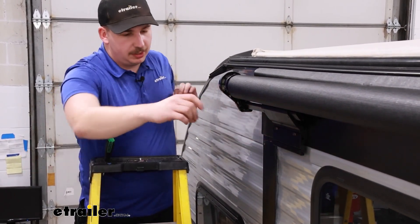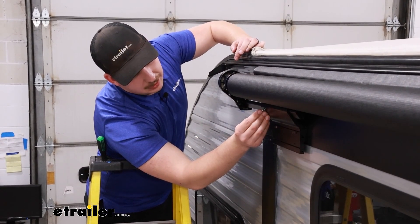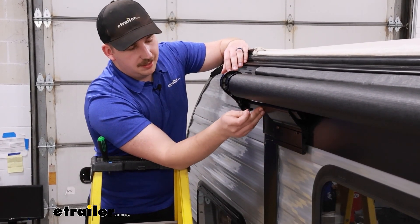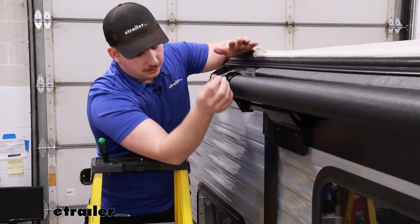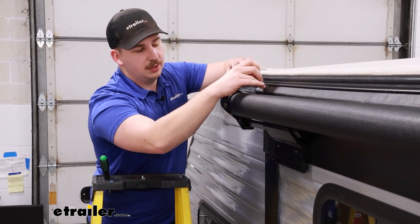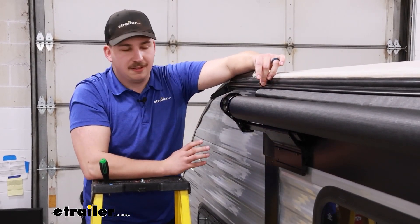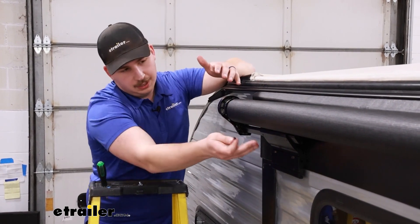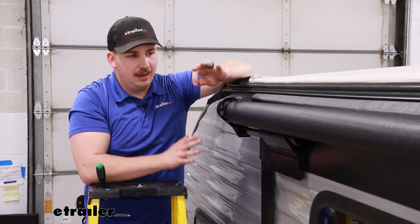The other thing to look at is the two silver self-tapping screws in the kit — those will go into the extension arms through the two holes up here. Because we're doing this for demonstration purposes and not leaving this installed, I'm not going to drill these in permanently, but it is completely necessary for your install if you're leaving this in place. In addition to that, there are two smaller black self-tapping screws that will go in place up top to hold the anchored end of the slide topper into the channel, just going in about an inch to hold it in place. All of those screws are completely necessary — you'll only do it once for your installation, and they're going to be the anchor points to keep everything still and make sure nothing shifts when going down the road.